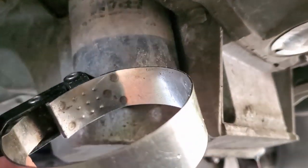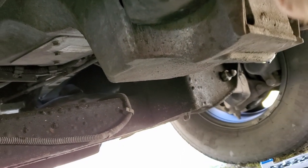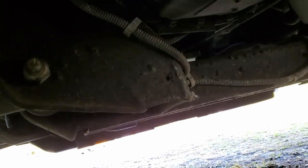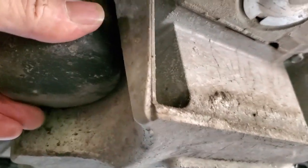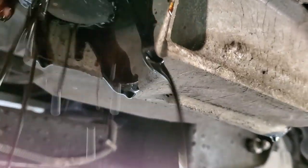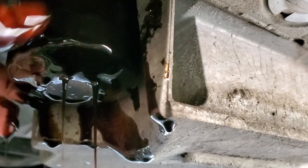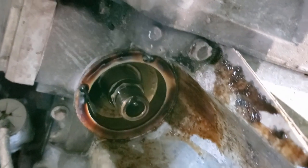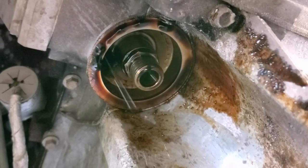Do not do this. You can see how that oil filter sits there. Get your oil filter wrench up on there. Remember, this uses tension to tighten it up, so just get it tight and break it free. Just break it free a little bit and that oil is going to start to come out of there because of how this is designed. Then we can just spin it with our hand and let it all come out. I'm just going to let it drop down into the pan. It does make a mess — you could wear gloves, of course. I don't like how Chevy designed this, but I understand why: this allows all that debris to drop down into your filter. But what a mess when you go to change it.